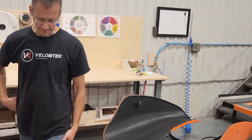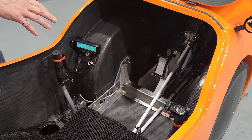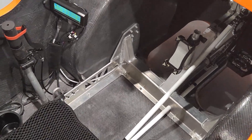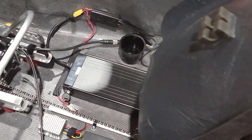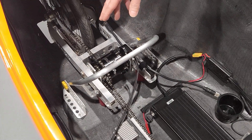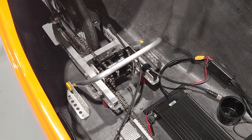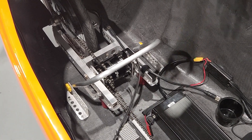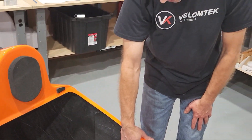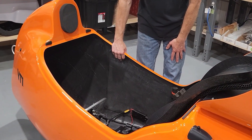On the interior side, we updated the shape and design of the aluminum frame. It was longer toward the rear side, so we chopped about 20 inches from the rear because it was under less mechanical stress there. This provides more room, better access, and reduces the overall weight of the vehicle.